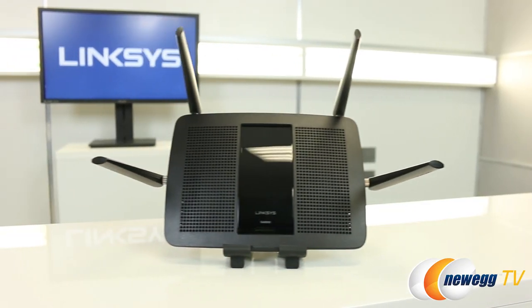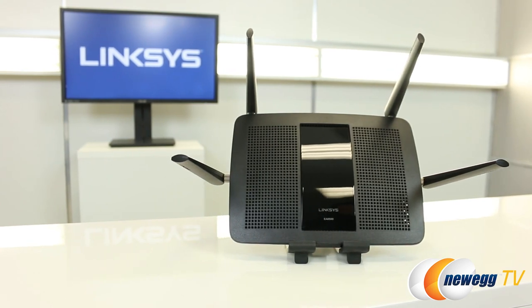And how does your internet connection speed actually factor into this whole thing? So, let's take an example. Let's say, for instance, you just upgraded to 100 megabits per second, which is pretty common these days. You can actually get 100 megabits at the edge of your network. This particular router can support up to 2,600 megabits per second, but that's right at your router. Most of the time, you're not sitting by your router — you're on your iPad in a distant bedroom watching a video, or maybe you have a distant game room where you're doing online gaming. You want to make sure that 100 megabits is supported throughout the entire network, specifically at the edge. And by having a more powerful, faster router at the center is going to help you do that.